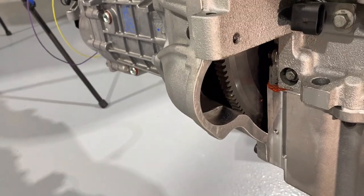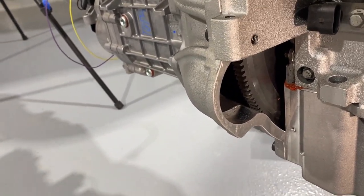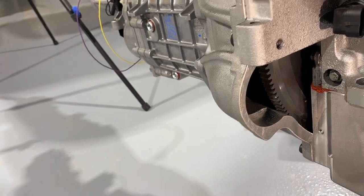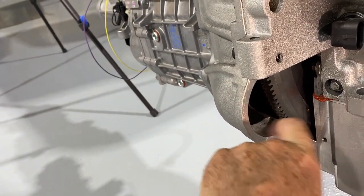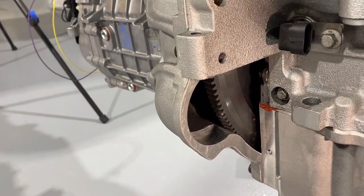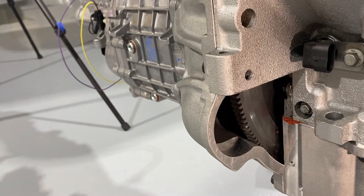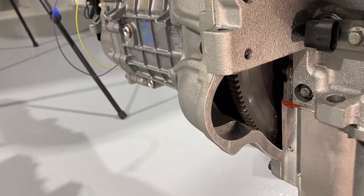So at least we know it ahead of time. With everything assembled as it is, once I identified exactly where the problem was, I had to grind on the outer casing of the starter snout so it would clear this raised area. Those are two tips — take it for what it's worth, it may help you on your next project. Comments below if you have any, I'd like to hear from you, and I appreciate you watching the video. See you next time.